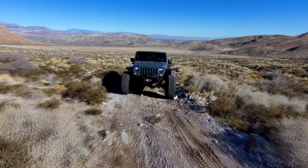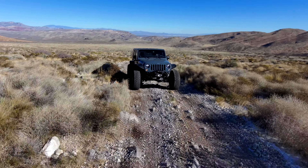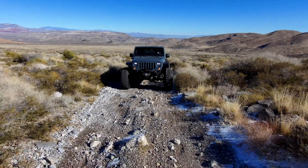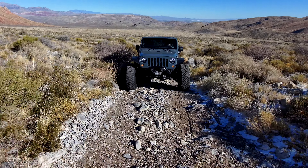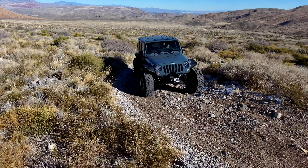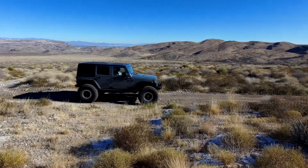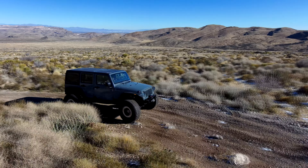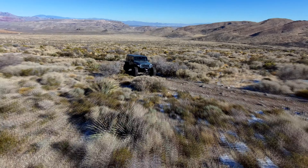The LT1 is rated at 460 horsepower in most production vehicles, and I can tell you they will outrun 500-horsepower vehicles from my experience, because again that bottom-end torque — bringing that horsepower in at low RPM — means you can gain that advantage. Now, if you've got a 600-horsepower LS3, that LS3 is going to come alive and eventually outperform the LT. But for most purposes and most situations, the LTs are just amazing with their bottom-end torque, especially in heavy JKs like the one I'm in.